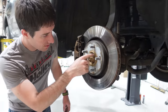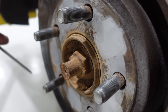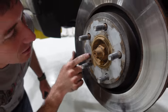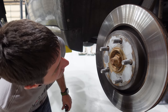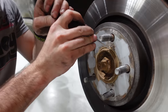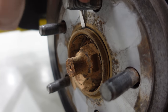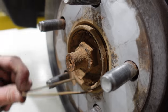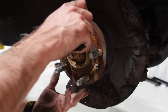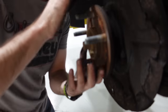Look at all that dirt — oh man, there's some rust in there. Here's something interesting I've never seen before: we tried to pull the rotor off and the rotor is retained. BMW loves to put a bolt there, a lot of other manufacturers use a tin. These rotors have been replaced — genuine GeoMet, the coated ones. There is an O-ring on the wheel hub that retains the rotor and it's actually pretty hard to get off without a hook. There's a retaining groove in there and then off comes the rotor. Oh yeah, it's this — listen to that thing. Crunchy. I don't think it could be more crunchy than that.